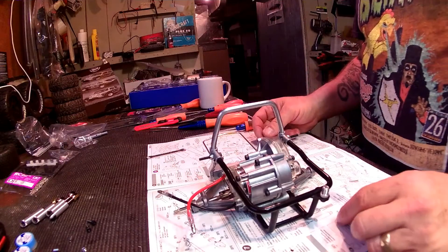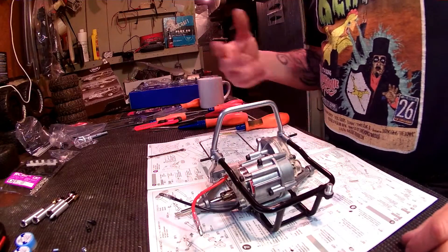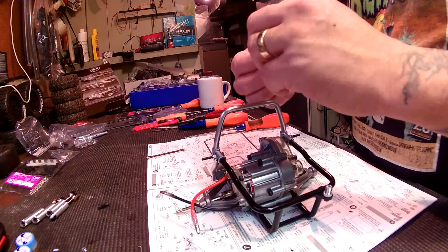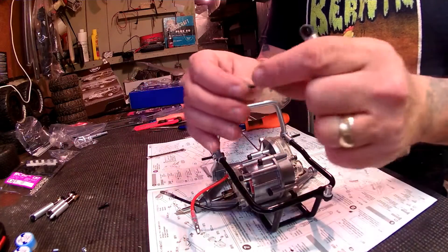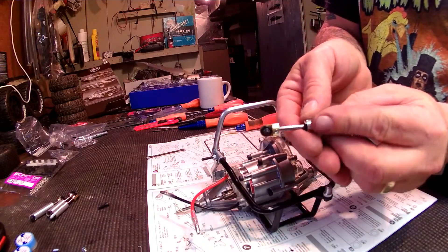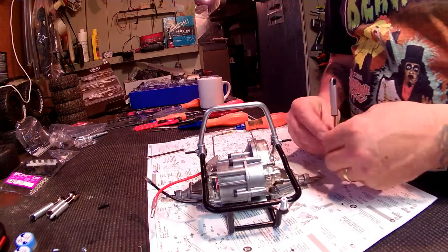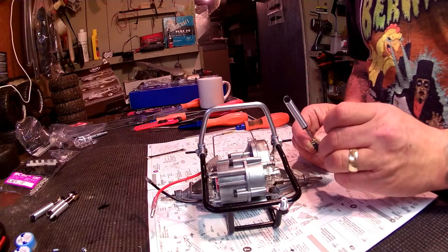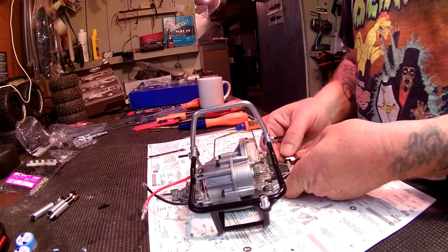All right, now what's next? BC3. So we have this guy, this guy, and one of these - I'm assembling the shock sleeve nut, and they're going to go right in there like so. Then they're going to screw right inside that hole there. Maybe I should use a little loctite on them, just a bit - it's always a good idea, metal into aluminum. You know, it doesn't hurt to put a spot of blue loctite folks - stay away from the red, use red you're dead.